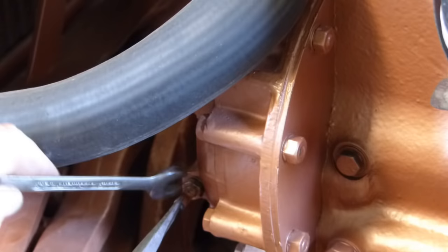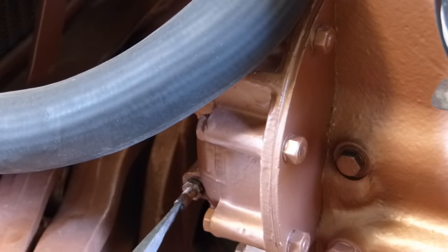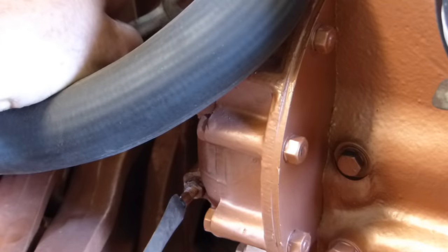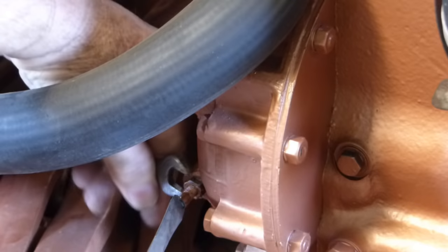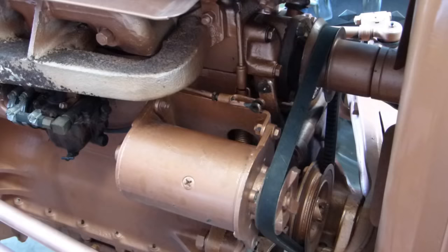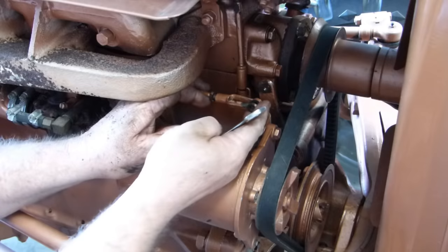What I found works for me is where the rod comes back against here, there can be a little bit of wear. I take mine in about a turn more — sometimes even two turns and it worked great. That just brings it forward a little bit to allow for where the mushroom on the governor rubs up against the housing. Whether you decide to do that or take it to where it just touches like the book says, that's entirely up to you. You've got to have these so you can turn them — mine's a little bit tighter than I would like, but we'll work with that.